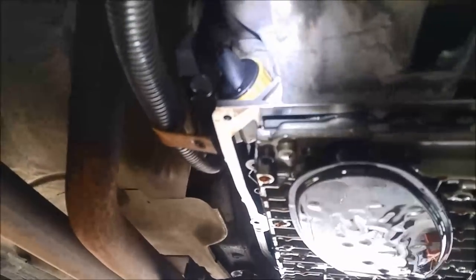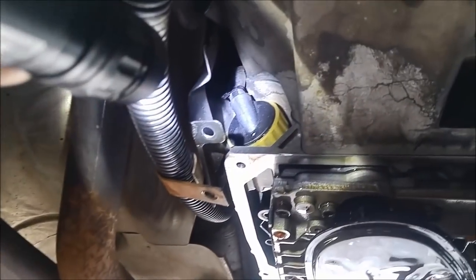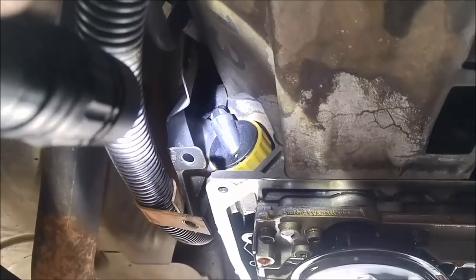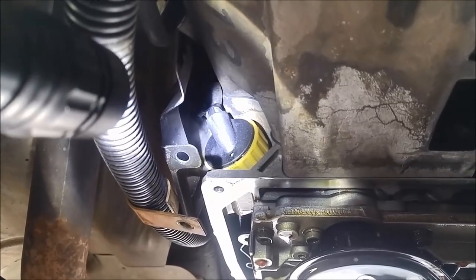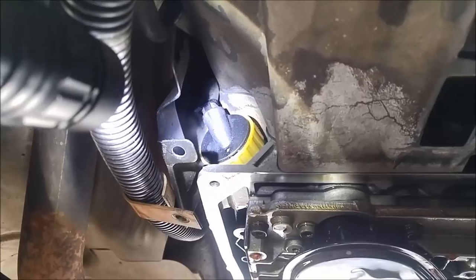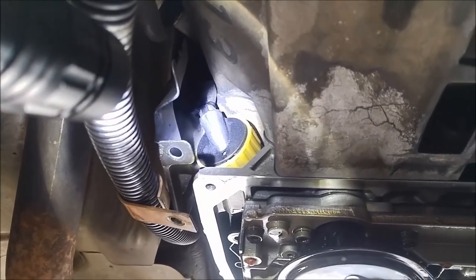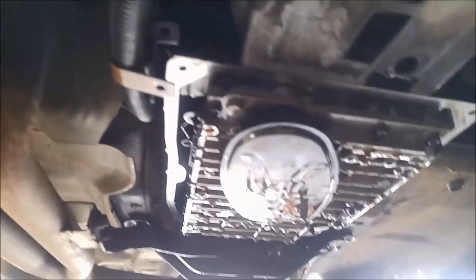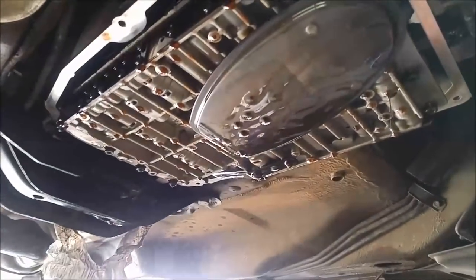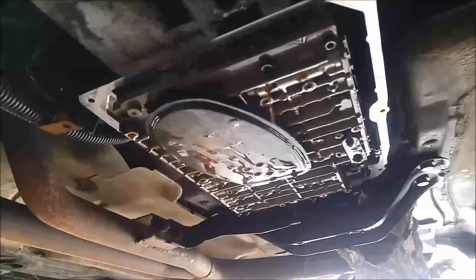Have a look over here — there's a little what's called a connector sleeve. Now these quite often leak, and you can get oil shooting up under the dash inside the vehicle. It's always a good idea to change those out. The sleeve is made out of plastic and it's got some o-rings on it. The plastic is very thin and it deforms over time causing it to leak. It appears we're going to have to take the valve body off this one and clean up that conductor plate — we'll possibly replace it and see what it looks like when we get it out.